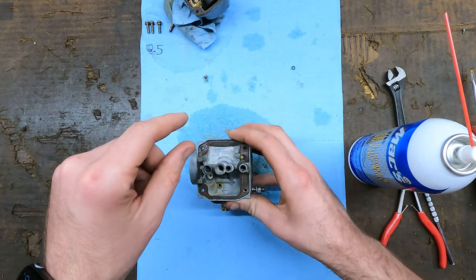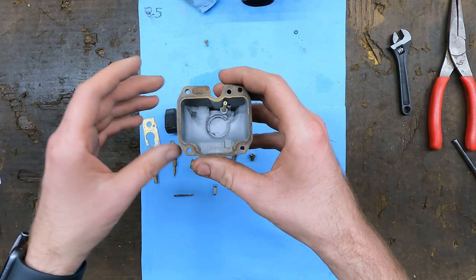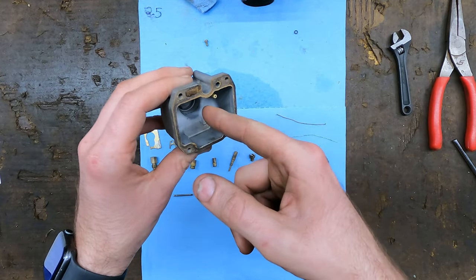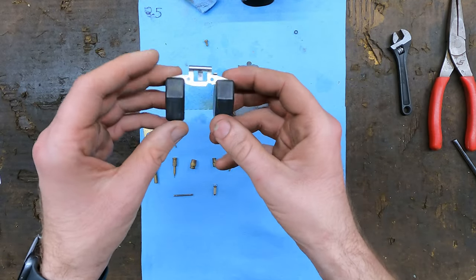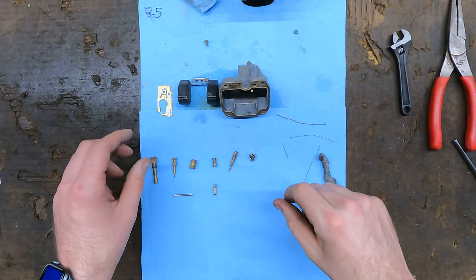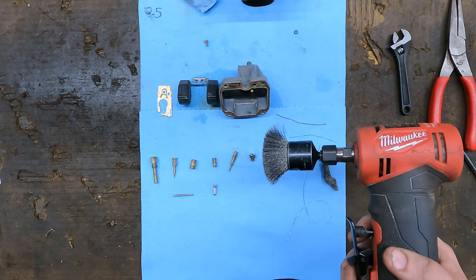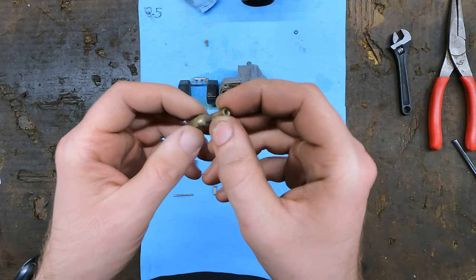I'm going to finish getting this cleaned up and then I'll show you a little more on cleaning up the jets. I've got a lot of this cleaned up now. This carburetor bowl was absolutely disgusting - I might get one out of every 75 carbs probably this bad. I scrubbed it as good as I could and it still wasn't good enough for me, so I stuck this in the sandblaster and shot some cleaner in here to get it cleaned up. I do have the float bowl cleaned up now. I took the float itself and sprayed some carburetor cleaner on a rag and wiped that off. I've got these metal pieces cleaned up and all my jets cleaned up. I like to use this electric die grinder with a super fine wire wheel - I'll post the link in the description. This works super good for cleaning up fine brass pieces and gives it a good polish.